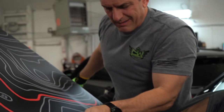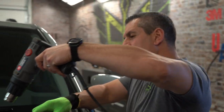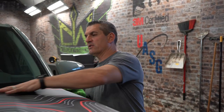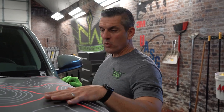When you're cutting that back edge, you can do it with the hood up or down — probably easier with the hood down, but for quickness and ease of filming we left it up. If you're working by yourself, you're going to notice I did a little back and forth. I like to focus on an area — everything's got a system. Did the center, went up top, finished it out, moved down, did each side, finished the corners, finished the back. That way you're not missing anything. People want to get in a hurry — you miss something, one little edge, and the whole entire thing fails. Part of this type of work is being as perfect as possible if you want it to last and look good.